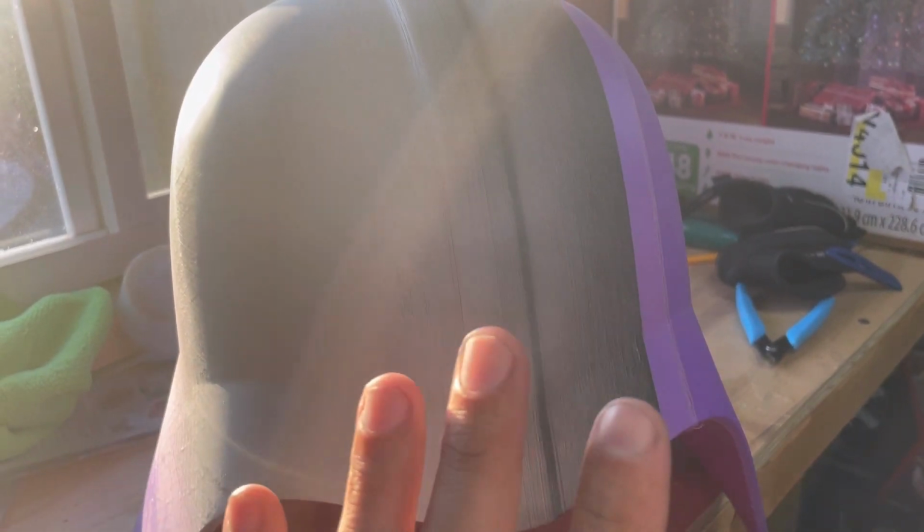Then I wiped it all down and repeated that process. One coat, waited, another coat, waited. But then I did a little bit of 220 just on where that seam was, and then 320 and 400, and boom. The reason I did the 220 is because I wanted to make sure that anything sticking up was leveled down. Now you can do that on the initial, but it looked pretty smooth. I just wanted to make sure for good measure.